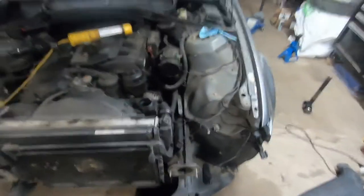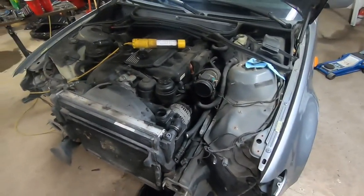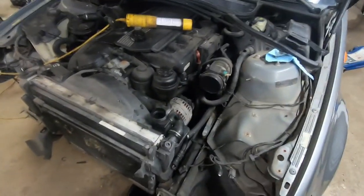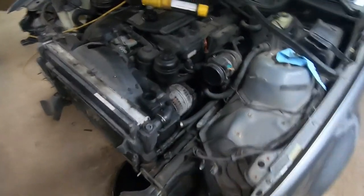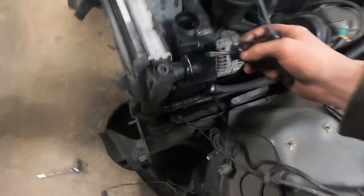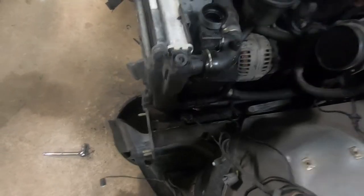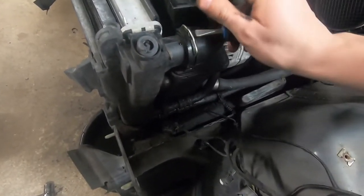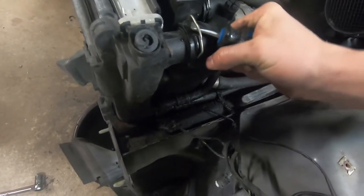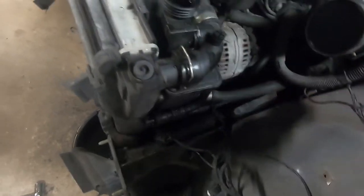The other thing you've got to do is undo all the hoses — that's the next thing I do while that drips. Most of the hoses use this kind of clip system, so I'm going to grab my slot screwdriver. So next is pulling off the hoses. The rad hoses use this kind of clip here — you use a slot screwdriver and you just pry up on this clip, put it up underneath there, pry up on it, and that'll disconnect the clip.